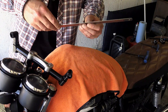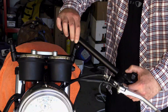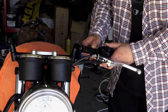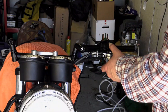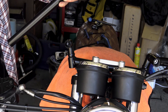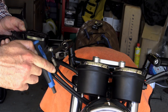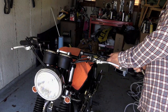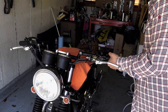Fasten your clamp down loosely so that you've still got some easy freedom of movement, then take some measurements on either side and make sure that you've got it totally central, then tighten it down fully. Once you've done that, it's time to put your actual handlebars on and replace your switchgear and levers. Simply insert your clip-on part into your switchgear and then offer it up to the socket and fasten it in place using your 10mm Allen bolt. Repeat the same process on the other side. Don't tighten everything up fully to start with — just make sure it'll stay in place while you adjust everything. There is going to be a certain amount of trial and error involved in getting your positions exactly right. Refitting your left-hand grip with compressed air can be just as easy as when you removed it — get it started and do the reverse of what you did to get it off. You'll get a cushion of air between the handlebar and the grip and it'll just slide straight on.